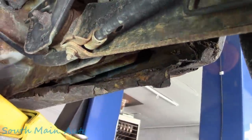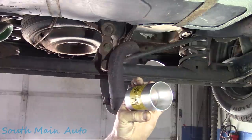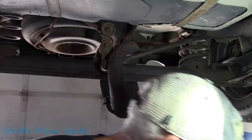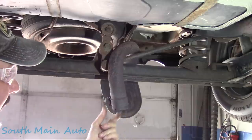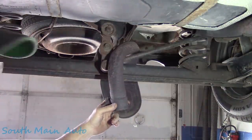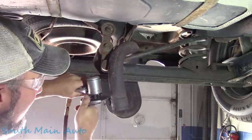It's getting a little flappy down here on the corner, so we'll see what we can do. I think the best bet is to just chop it off here. I've got us an inch and a quarter sleeve from Napa — it's your 41-951, pretty classic. We'll cut it off, get the piece that's still in there out, and then we might have to expand this out a little bit and weld it on. That's probably our best bet. Get your safety squints on and we'll chop it off.